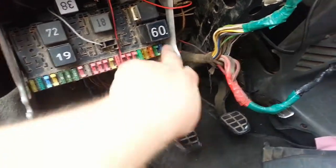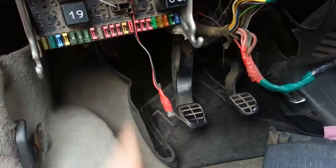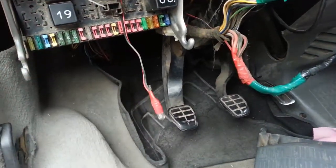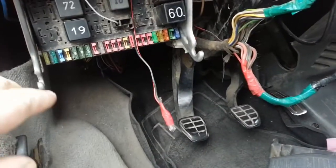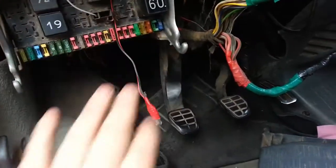You run through fuses 1 to 15, there's another fuse up here, another fuse up here. Only one of these actually works for the electronics, the rest of it is lights and stuff. So going through elimination, check your lights — still got lights, so you know the whole board isn't dead.